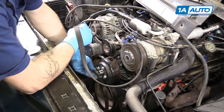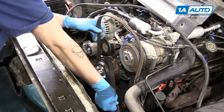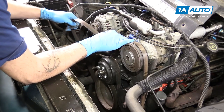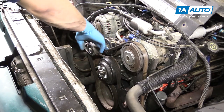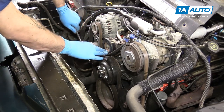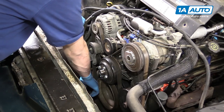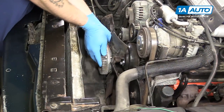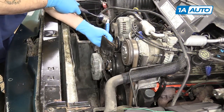Loop your serpentine belt under the crank pulley, then go under the water pump, around the top, down and under the power steering pump, over the AC compressor pulley. On the left, go over the tensioner and over the alternator, then hold down where it'll go below the idler pulley. Using the drive from a 3/8 ratchet, turn the tensioner counterclockwise, slide the belt under, and take a quick look to make sure everything is aligned. Put tension back onto the belt. Reinstall the clutch fan and just snug it up by tapping it on with a wrench.